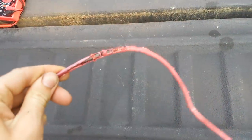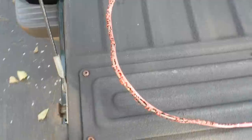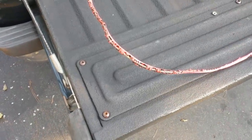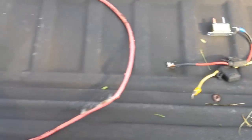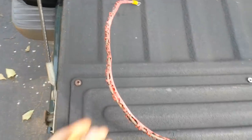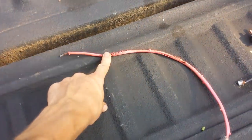The wire itself was 8 gauge, so it was more than enough to handle the current that whatever accessories were on it would draw. But what the installer failed to do was install either a fuse or a circuit breaker right at the battery. Matter of fact, there was no fuse at all. Each accessory had fuses on it, but that doesn't really do too much if the wire short circuits at a point before the fuse box.